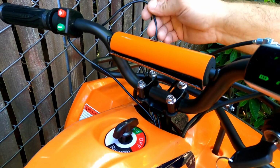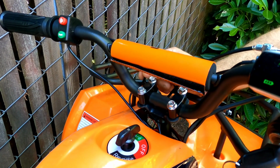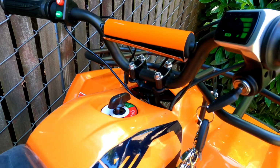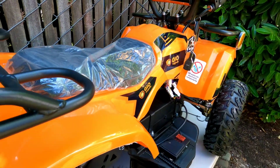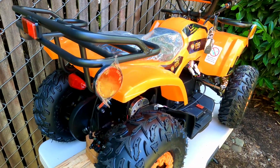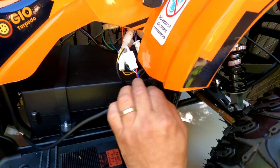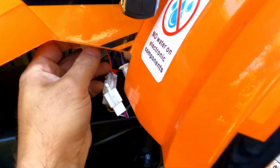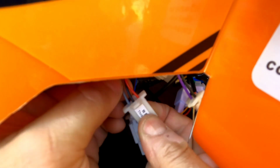Anyway, so again, if you have a rear stop light on, machine will not move and this test will not be valid. So in my case, the rear stop light is off. The only way it can be on again is if I press it. And then I'm taking this paper clip, looking for that 3-pin plug that says throttle, and connecting 2 wires together, gray and the red.